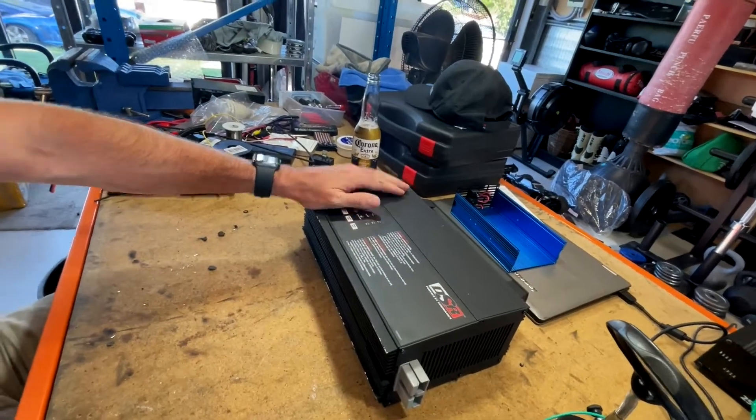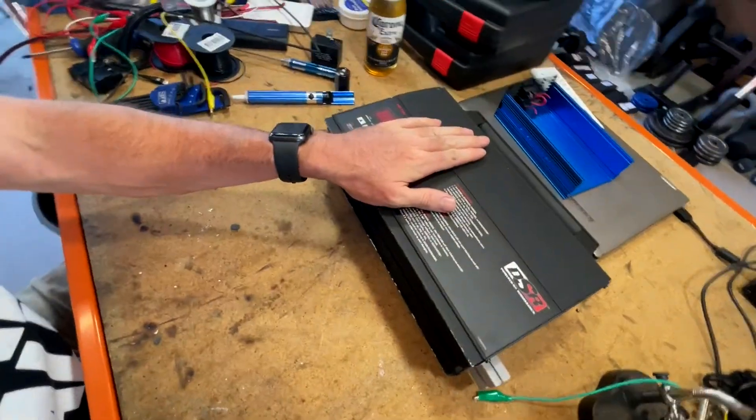I'm going to end this video with a question — hopefully someone can help me out, and hopefully other people with the same problem will benefit too. I cannot find anything that's wrong with it. To recap: it thinks the car's battery is at a much higher voltage than it is. Testing with a multimeter at the terminals, the charger thinks there's about 14.4 volts when there's actually only 12.6 volts there. It's almost like the charger is reading that there's already way too much voltage and not putting any output out. If somebody knows what that could be or things to check, please let me know. I'll keep this here for the time being — I'd love a conversation in the comments. Thank you for watching Test and Tune — this isn't a how-to-fix, it's more of a help-me-fix video. We'll catch you on the next one.